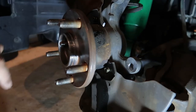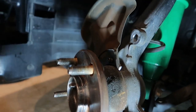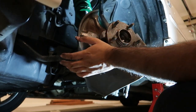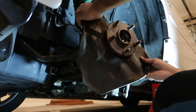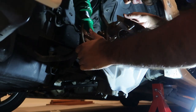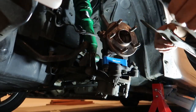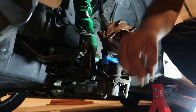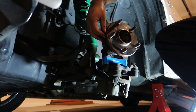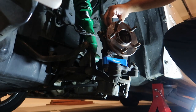Now that piece has been cut out, there are just four bolts with almost an allen key head that you need to undo. Once the final bolts are removed you should be able to bring it forward and wriggle it out. That's the heat shield there. Once you're done, don't forget to put those little bolts back in just in case you ever need to refit the heat shield, and to stop dirt getting into those threads.